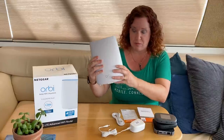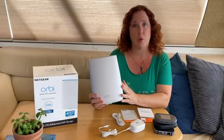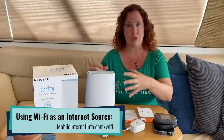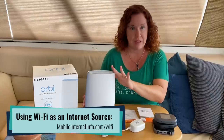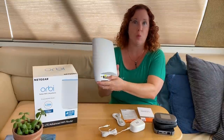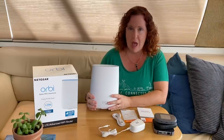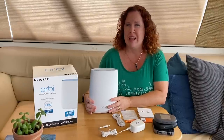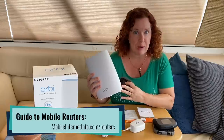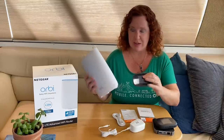What is lacking for our mobile audience: we're used to router-style devices that also support a feature called Wi-Fi as WAN — the ability to use another Wi-Fi network, like at a campground or marina, as one of your internet sources. This device does not support that. You would need something that can capture that signal and transmit it via Ethernet to use it via the WAN port. It also does not have a battery, and it's not easy to bridge in other cellular devices — there's no USB tethering like we see on mobile-specific routers.